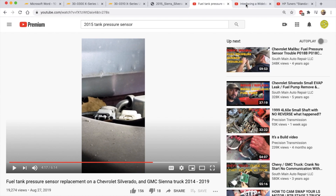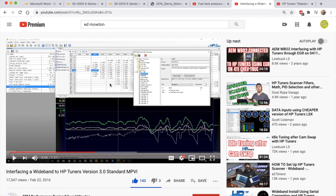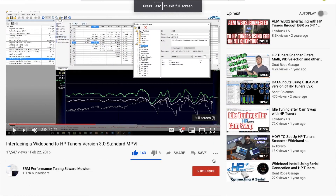One thing I forgot to mention: you'll have the fuel tank pressure sensor in your channels, so right-click on it and update — increase the polling rate. The polling rate on the fuel tank pressure sensor defaults at about one time per second, which is too slow for reading AFR data. Set the polling rate to 20 milliseconds or 50 milliseconds and it's super fast — faster than serial, blink-of-an-eye type stuff.